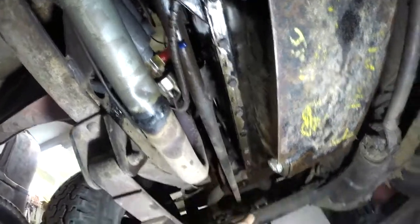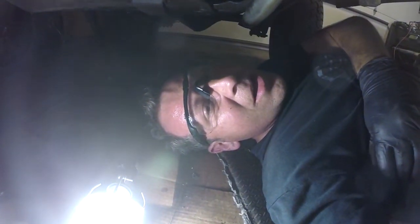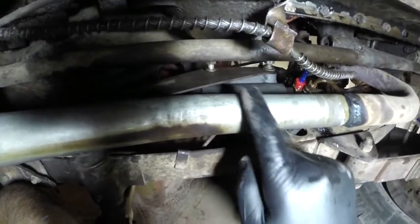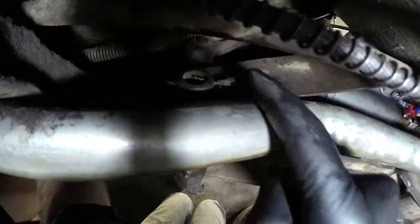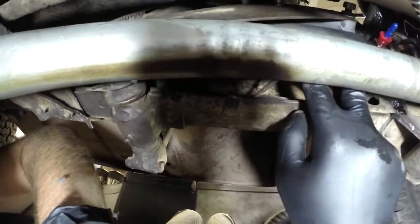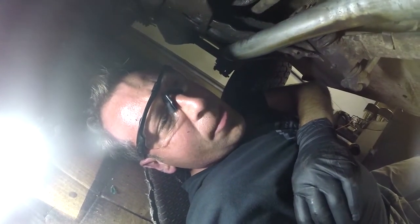This PTO for the winch shoots right through here where you need it, same with the exhaust, so it's really in the way. The trick to get these bolts back in — even without the exhaust pipe or PTO shaft, it's still a pain because the bell housing and transmission are in the way. So you come right up here, take this cotter pin out, slip this metal bracket off of there, then you can lift up the master cylinder, swing it up out of the way, get the back bolt in, drop it down, get the front bolt in, then come back, put the bracket back on, and drop that cotter pin back in. It's kind of a puzzle, but now I just got to tighten everything up and we'll be ready to bleed some brakes.